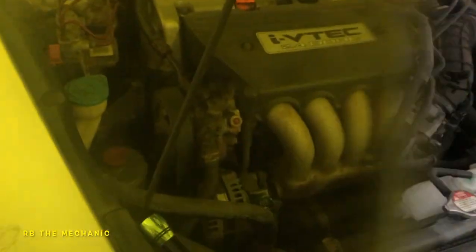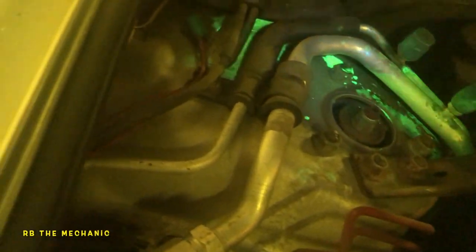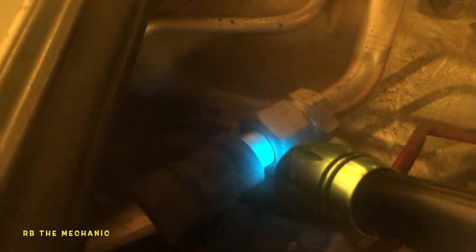I've driven the car for a few hours. Now we're going to take our glasses, put them in front of the camera, and use our UV light. You can see the buildup right there — that's from the spray I sprayed out earlier. Go along all the lines and check fittings like this one right here. This is a joint — you can leak from the seals. I do know I have a small leak right there; those are the line seals for the AC lines. The most common area is down here at the AC condenser.